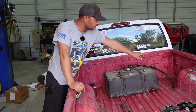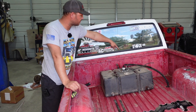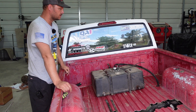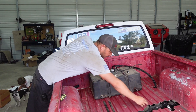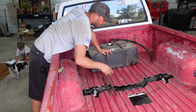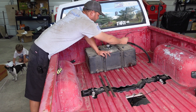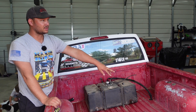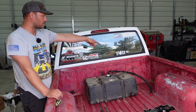So we went ahead and drilled a hole over there in that corner and ran these fuel lines through. I need some vacuum hose so I can build a little grommet to go there. We were grounded right here to this cross member, so I'm going to take both those off and take our ground straight to our grounding lug for our battery. Our positive wire runs back to the relay, so we'll have to bring it forward.